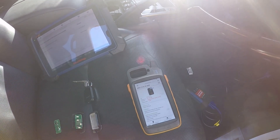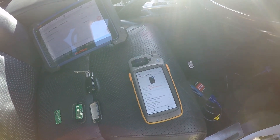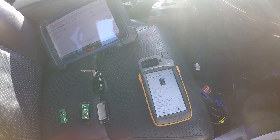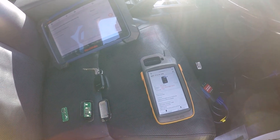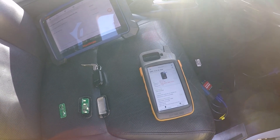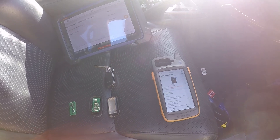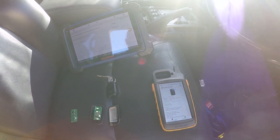Just a bit of information: Toyota and Lexus are made by the same people. If you can't find the correct key in Lexus, or vice versa in Toyota, go into the other one and see if you can find it. This has programmed in straight away — doing the key has taken us less than five minutes in total.